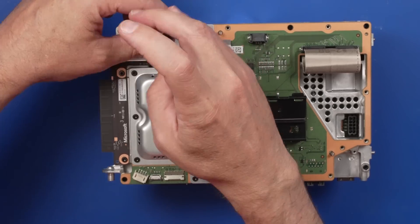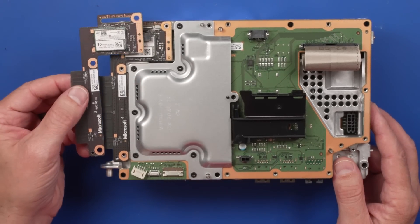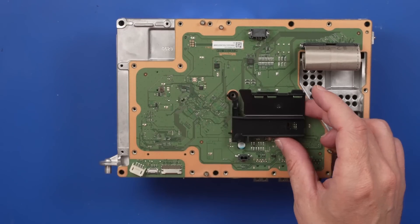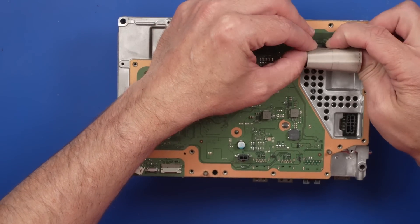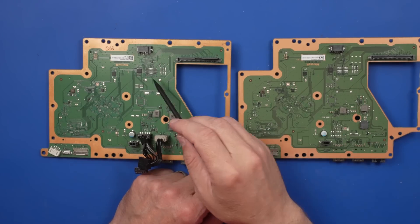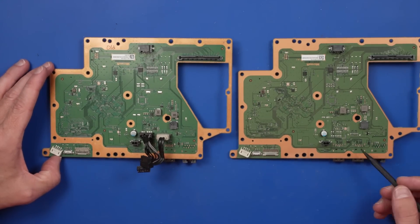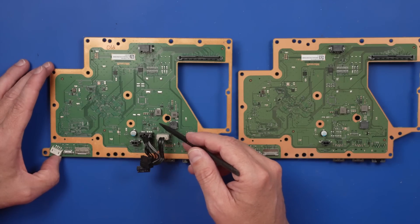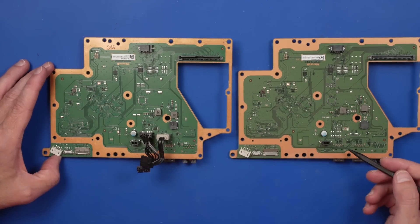Next we'll remove this board — there are just three screws that hold it on. The old style totally fits on here and looks exactly the same. Now we've got seven screws to remove this metal plate, and with those removed the plate just pulls right off. We need to take the plastic bracket off, unhook this ribbon cable by pushing in the tab, then rock it back and forth as we pull up. Now comparing the new board with the old board, it's essentially exactly the same — these connectors all look exactly the same. There's a bunch of components around here that are not installed on this new board but are on the old board. If you'd like to see a video of me installing those components to see if the disk drive will work, let me know in the comments.